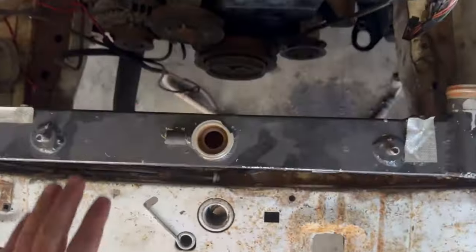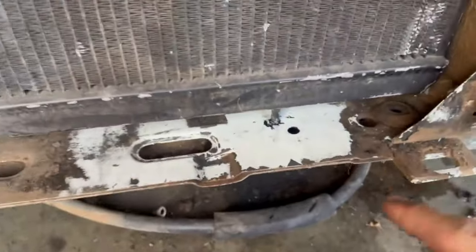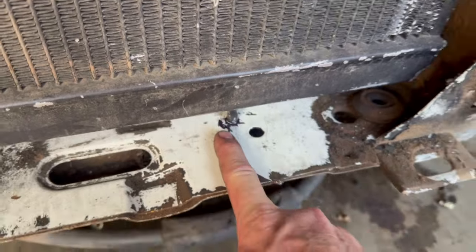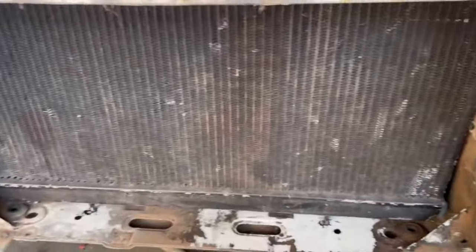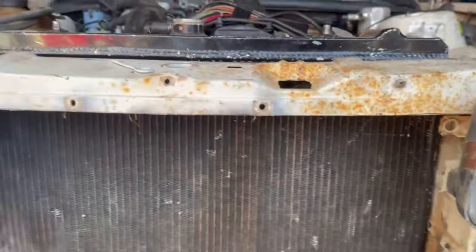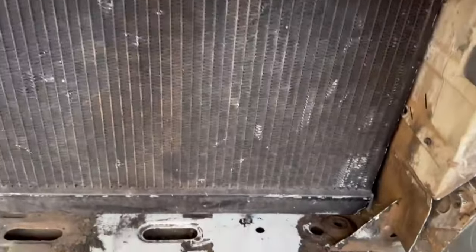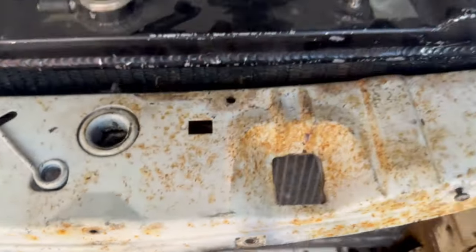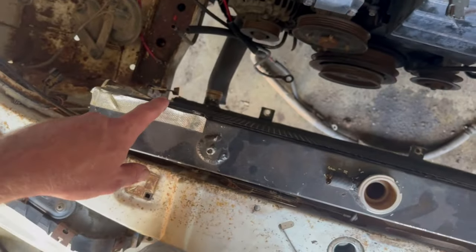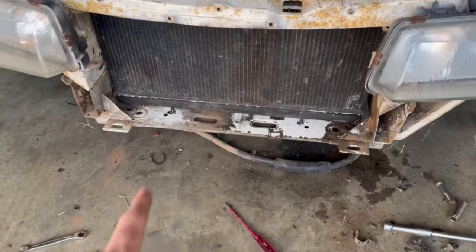All right, change my radiator, because I have a whole pile of old radiators out of the Corolla. So this car's getting built with 90% hand-me-down parts, hopefully. So I marked the other radiator, as you just saw, and I thought, you know what, seeing as I'm not actually running that radiator, I better double check that the other ones are the same. And yeah, definitely different. So this one, even though it's a direct replacement, holes are in a slightly different spot. It's probably 20 mil narrower than the silver one that was in there before. So I've decided I'm going to mount this one, even though, once again, it's still not the same as the one that I'm getting, which will have both holes on this side, but I'm 90% confident the new one will be the same as this. So anyway, I'm going to drill these holes and mount this radiator.